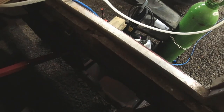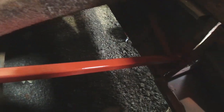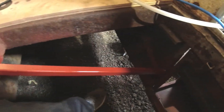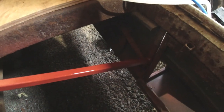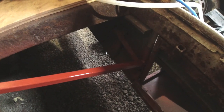Right, so just outside here are the steps, and as that used to close in, I don't know if you can see that very well, it used to snag on this bolt here. That's because this piece of metal here was cut down and replaced, and it allowed this panel to flex inwards. So that's now been replaced and welded in, and it's been red oxide coated.